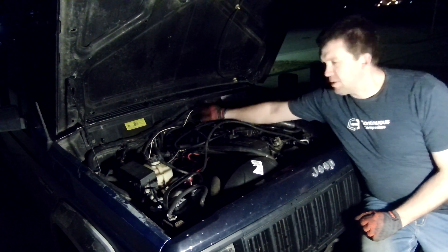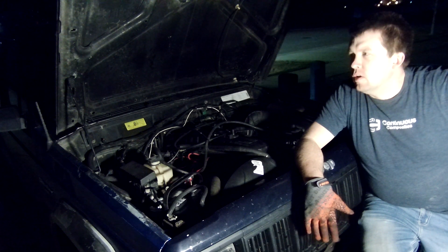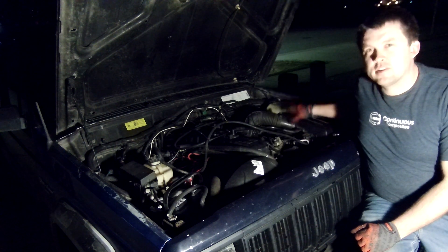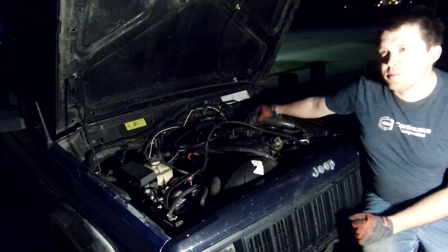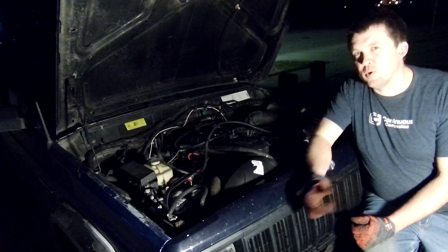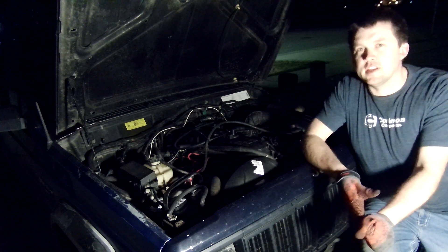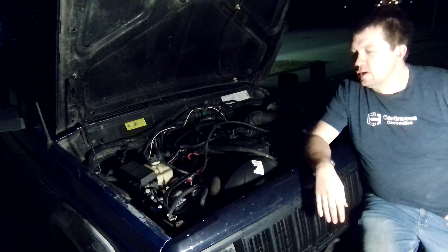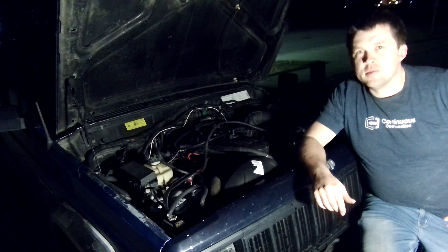I got the valve replaced and the elbow replaced. I did check and the old one was flowing, so worst case these parts were $15 on Amazon — easy fix, quick fix. I cleaned up the air cleaner box, and I'll run around for a few hundred miles, open it up, and check again to see if there's still oil in there. If not, hopefully we fixed the problem. If oil is still getting in, I'll have to do more digging. Thanks for watching — like and subscribe if you want to keep up with the new Jeep project and follow along on our family adventures here in North Idaho.